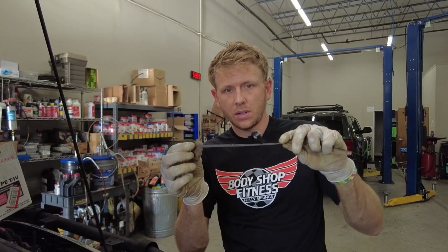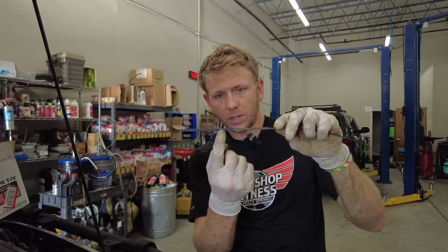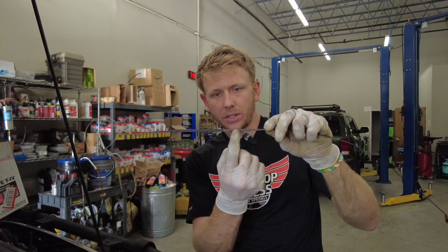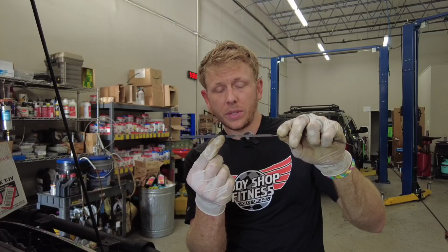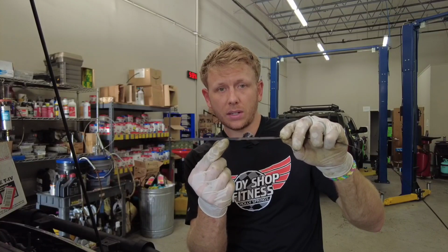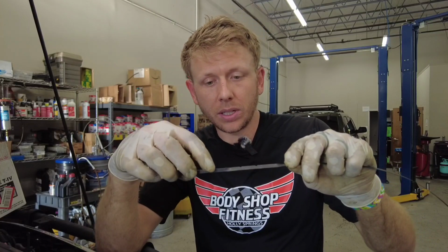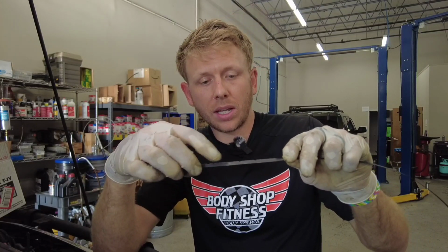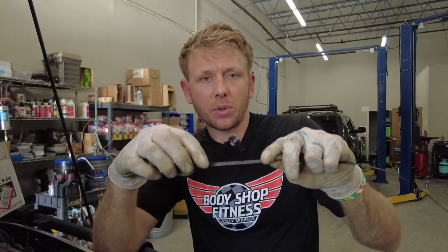Alright, so on this truck, the transmission fluid dipstick has a cold range and a hot range. They're both to be checked when the engine is running. So that gives you 2 options. You can check it when you first start it and then confirm it later when it's warmed up. And that's generally operating temperatures.